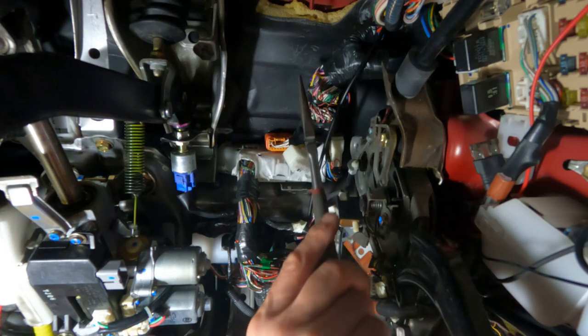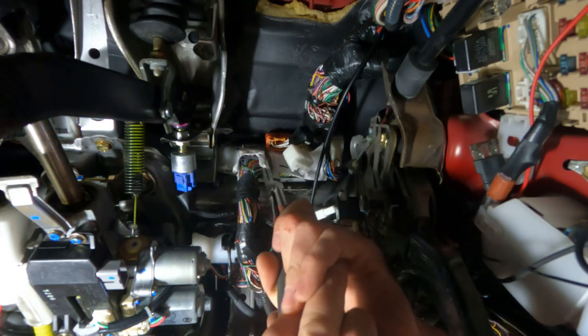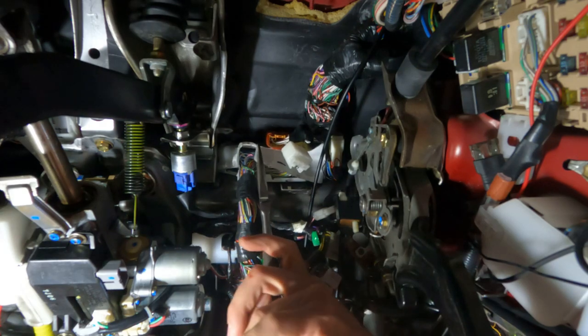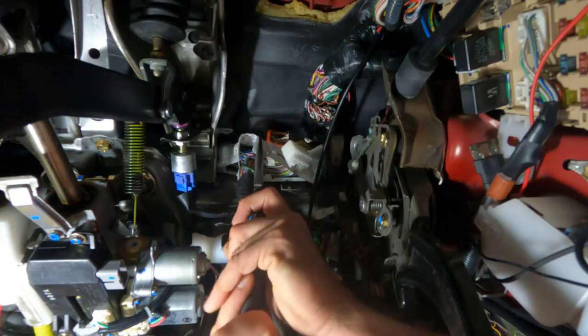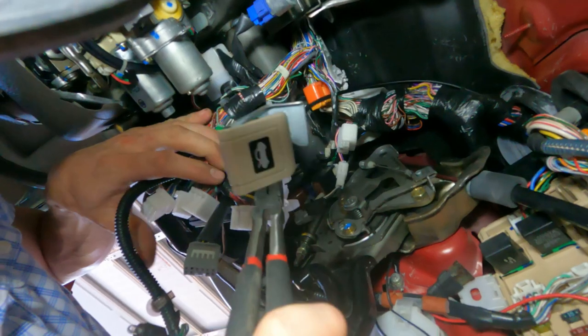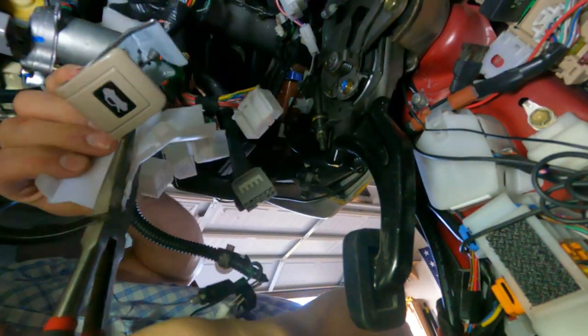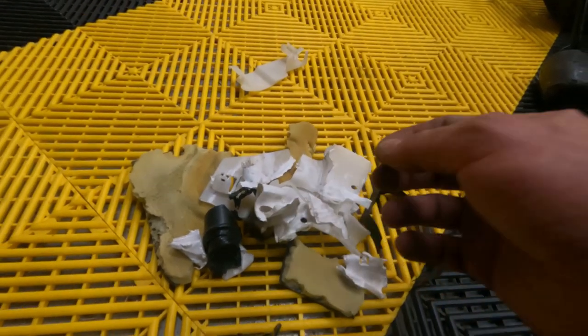The reason you have to do that is because this whole main bundle has got to move outboard in order for the clutch pedal assembly to fit up in here. The only way to get to this is either take your dash off, or pull on this and destroy it in numerous pieces — but you've got to be careful not to jam pliers into any wires. I'm purposely destroying this plastic that you have to twist and pull on up by the wire harness. You can see that's where it was before and it freed up a ton of room up there.